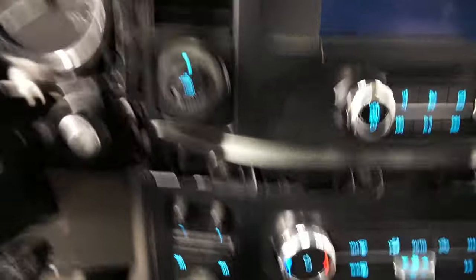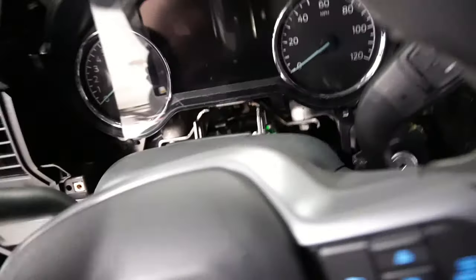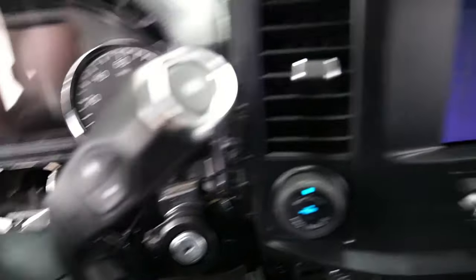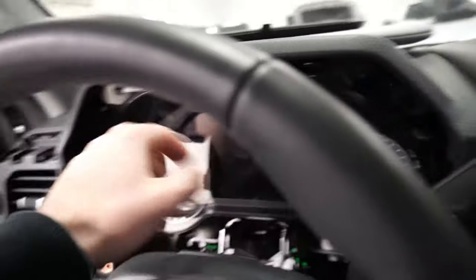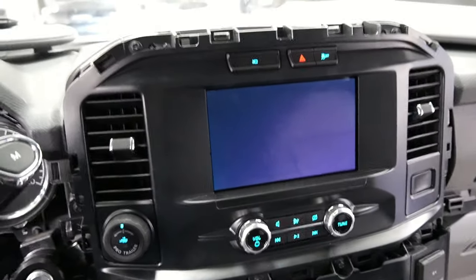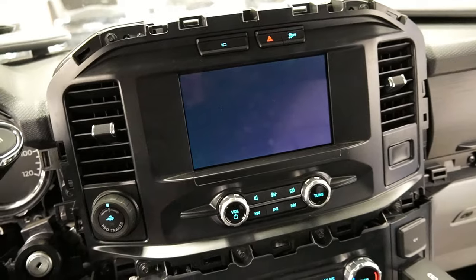For the cluster, pull that outside one off. You just need to pull this trim off, and then that way you can get this bezel trim off. There are a couple screws on that bezel trim that you'll need to take off here and down here underneath the key itself. Undo those, and then you can get your screws out — here, here, and then there's two on the bottom as well. We'll go ahead, pull those out, and then try to get this faceplate and heater controls off and get all this disassembled.